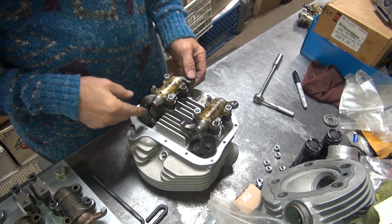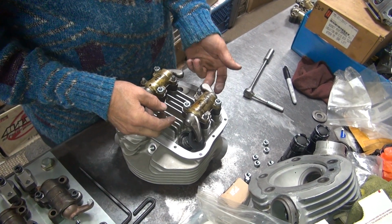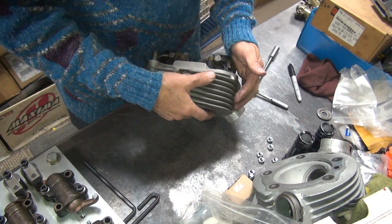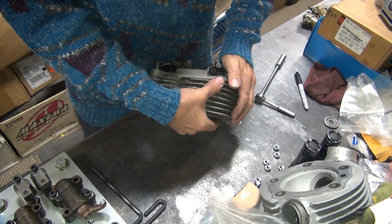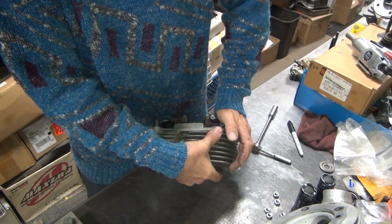The question was, if we keep shortening the arm, this cover gets up higher, it's going to come to hit the cover. The push rod will get way up in there, and it will at some point. So we're going to have to do a full assembled mock-up. Let's see how high it really gets to.